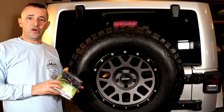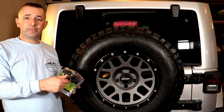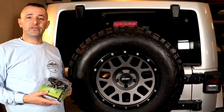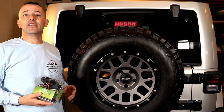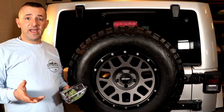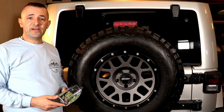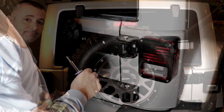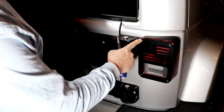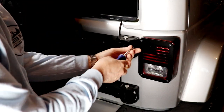What's nice about this kit is it's virtually plug and play. I'm just going to remove the taillights, plug in where the taillights plugged in, and then run a wire up to the front where it will connect to a six-pin connector that will allow me to connect to the RV. So the first thing I have to do is remove both sets of taillights to gain access back there. On a JK you only need to remove these two inner screws — back them out and the taillight will just slide over.